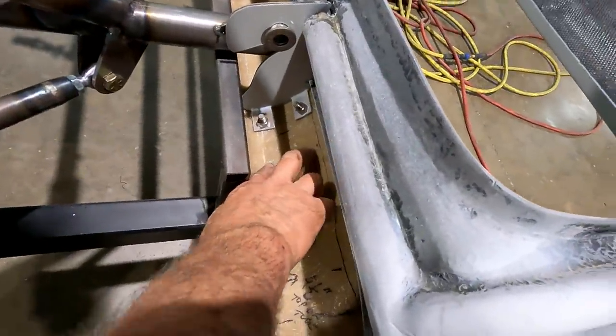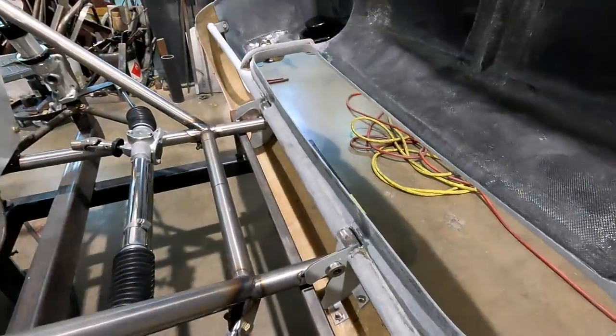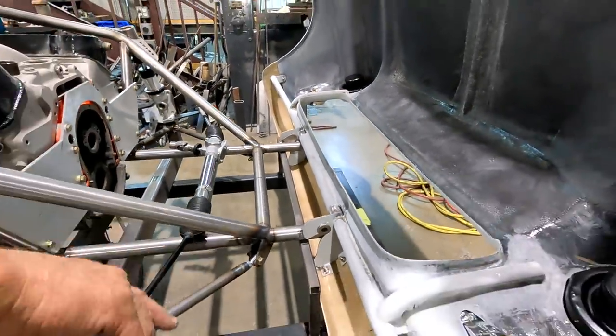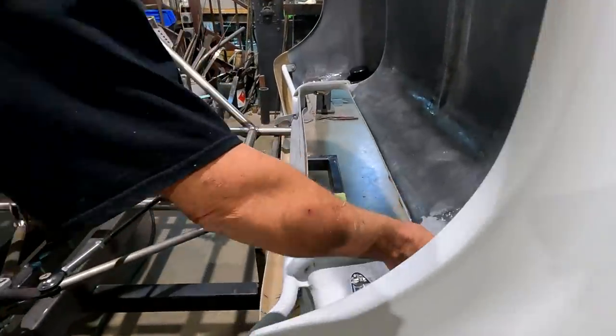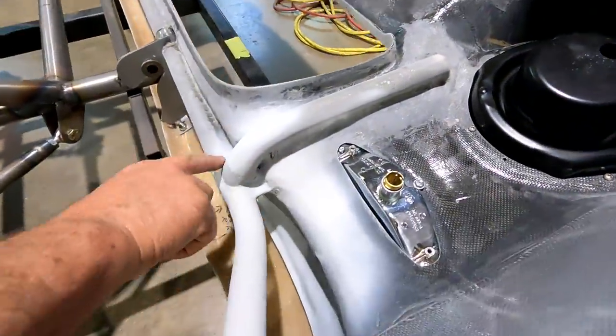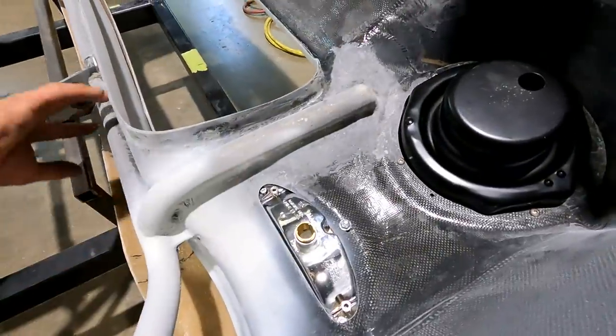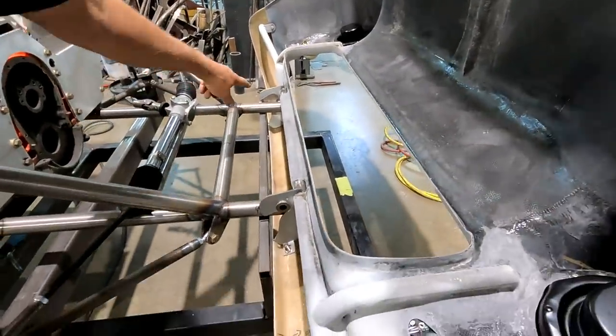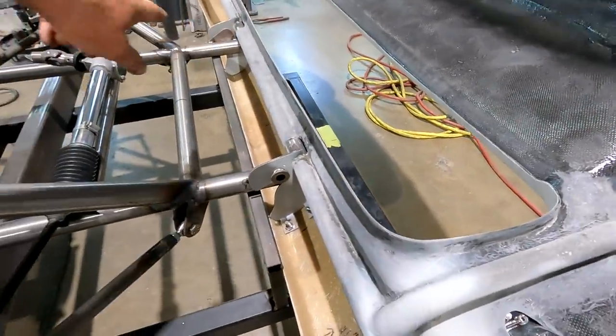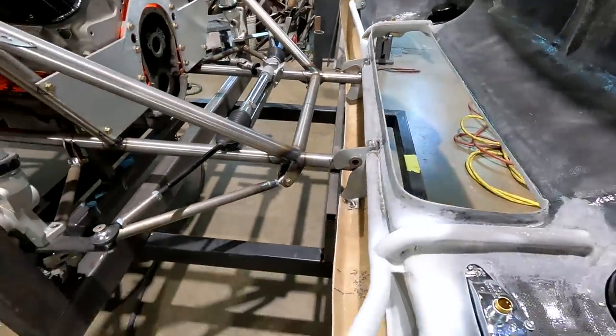The stock ones were over here, but my frame rails are narrower, so I didn't want to make long brackets or anything goofy looking. And then I built this, which is 1-inch tube that's welded here and glassed to the front end. So it's glassed all the way across. And I put stops down in here that'll actually hit the front of the frame horns or the frame rails